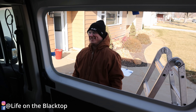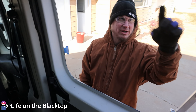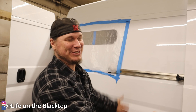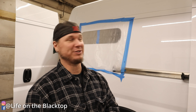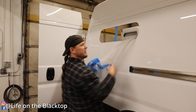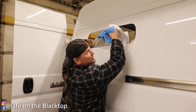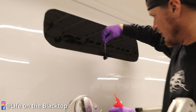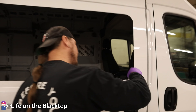That's a hole! Good job. I'm going to rough this up with some Scotch-Brite and then start filing, and then clean it up with the shop vac. Thankfully our neighbor has this store and is letting us use the back so we can park the van in warmth — it's so cold out and we're supposed to get five inches of snow tonight. The window glue can't get wet for 72 hours. We're putting on a little primer so the urethane adhesive will adhere.